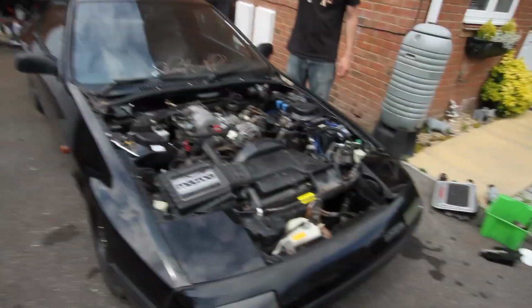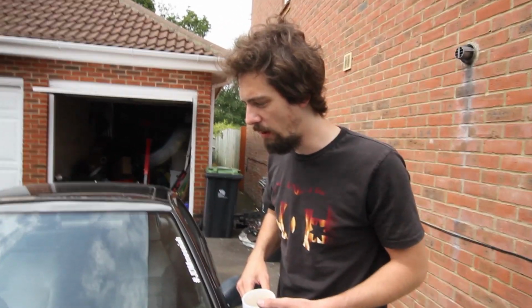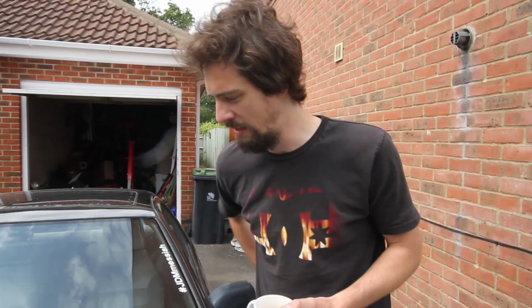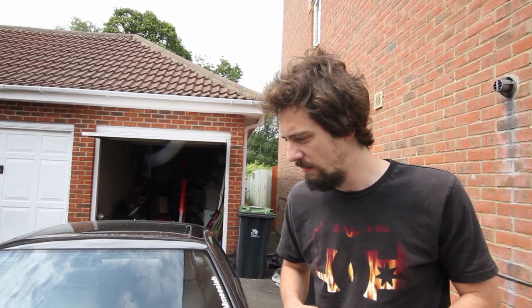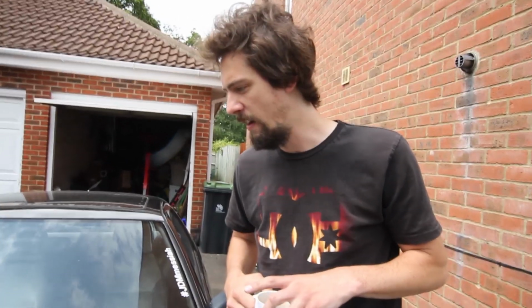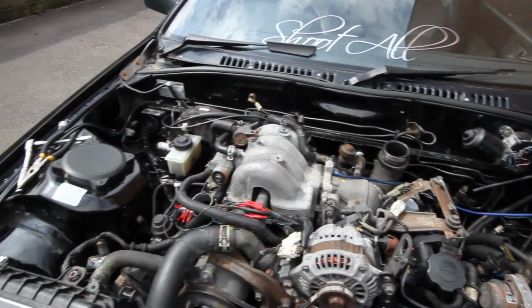Welcome to another day at Johnny's, the RX7 build. After the last time you saw it hesitating when we took it out for the first test drive, the guys have done some improvements. Basically we took the intercooler off and found a load of manky 24-year-old wiring. All the outer coating had cracked, and all the inner core was green and falling apart. You literally had to touch it and it would just disintegrate in your hand. That all ran to a load of sensors in the intake manifold, and the BAC valve, and general stuff to do with it starting and running properly.